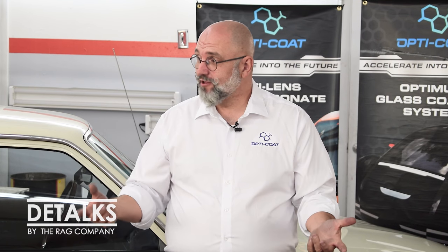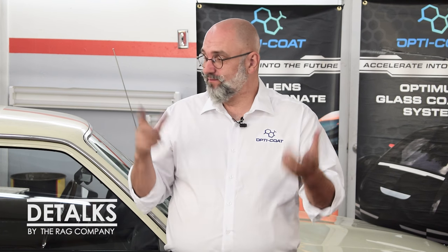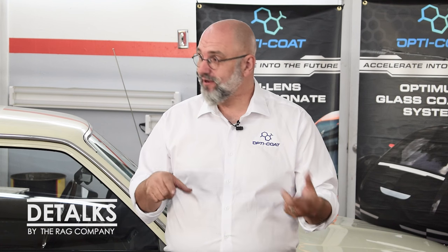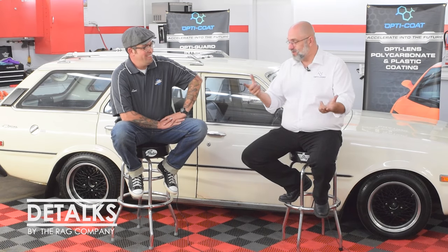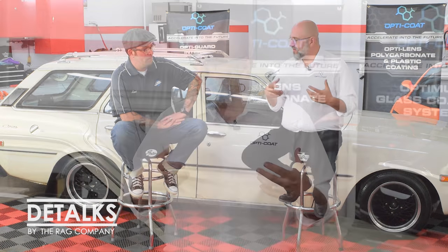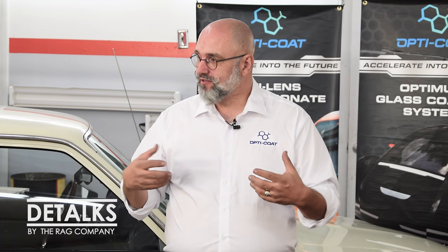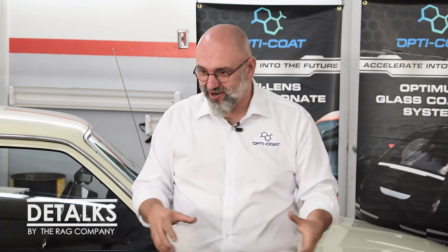I'm a three-finger polisher, two on the back end and one on the front. And people look at me like I'm strange, but that's how I like to use the machine. Sometimes I'll use four fingers, two in the front, two in the back. But I'm very delicate with the tool. I let the tool do the work. I don't manhandle the tool. It dances over the paint. And once you get to that point, it's a lot easier on your body as well. You're not holding on with a death grip trying to manhandle this tool.